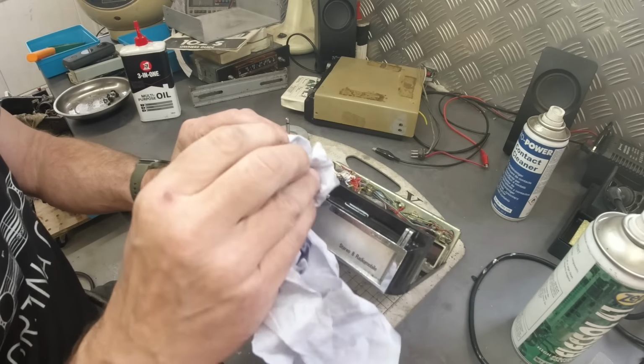Okay, power supply is connected and my finger on the other side is holding the... we've got sound, by the way. I just heard it. I heard the amplifier anyway. My finger on the other side is on that button, that's the power up button when you push the tape in the contact, and then I'm going to press it. You should see right in the middle, you see that copper thing that we just repaired, just there doing its job, so it's working. There's the head.